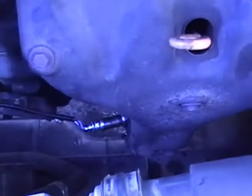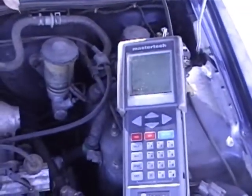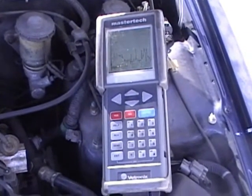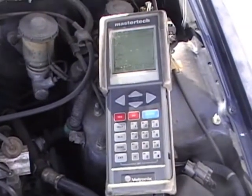And there you have it. So I hope you learned a lot more about oxygen sensors. That waveform I was showing you earlier is the exact waveform that your computer sees to decipher what fuel trim changes it needs to make to your fuel injectors to make this engine run at a 14.7 air-fuel mixture.